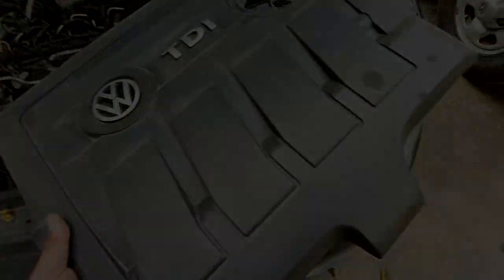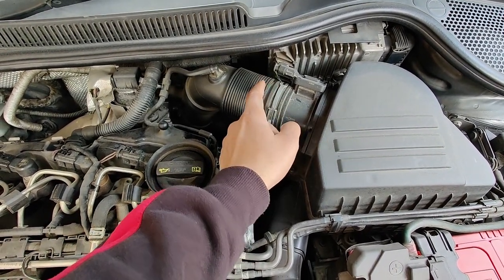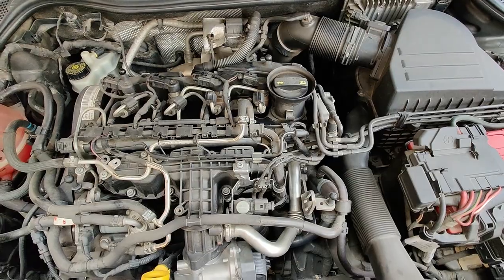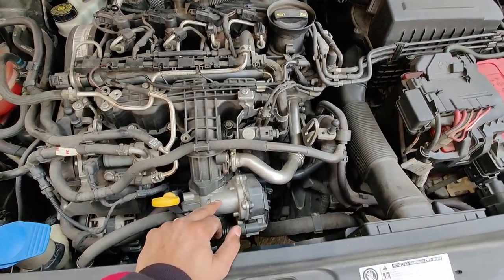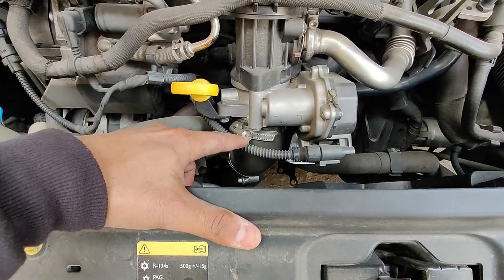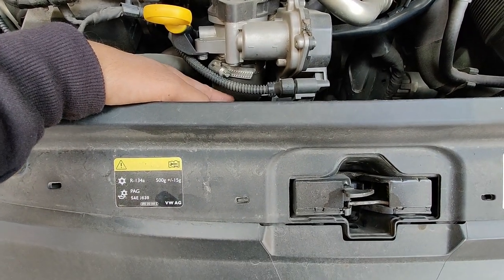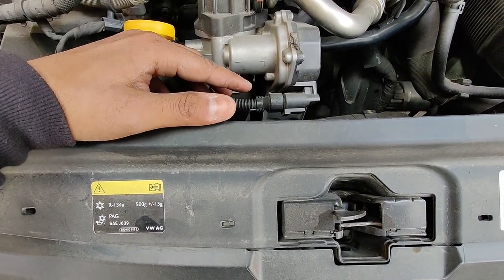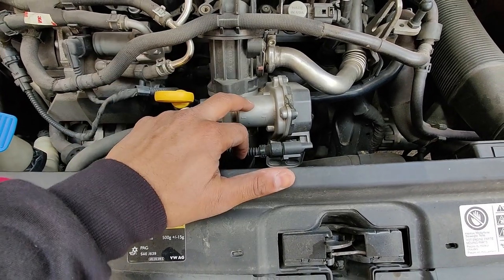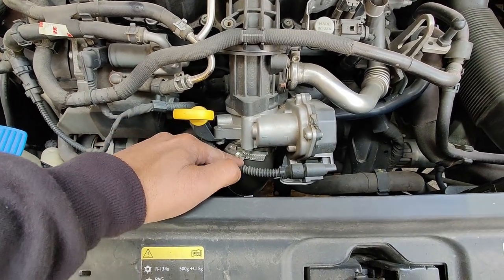According to the manufacturer, we need to disconnect the hose after the MAF sensor. But we're not going to do that because we've recently cleaned our intercooler and anti-shudder valve. What I'm doing instead is disconnecting the hose and creating some space to spray the content directly there, so our main focus can be just on the intake manifold and the valve stems. I'll link the anti-shudder valve and intercooler videos in the description and top right corner.